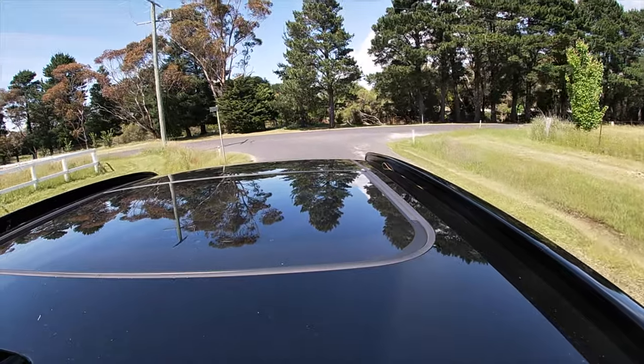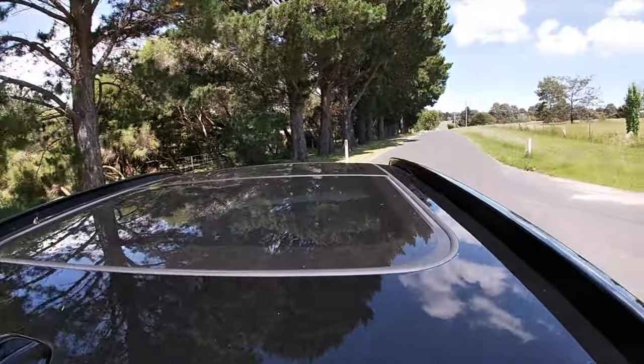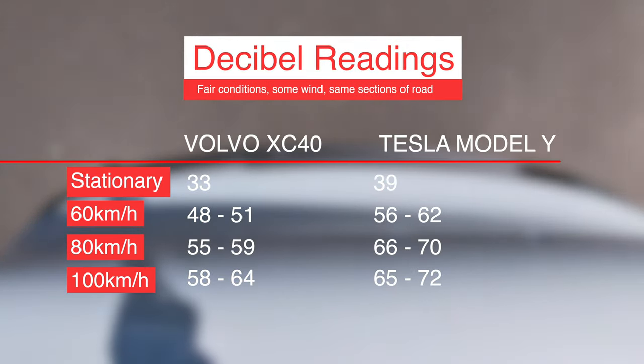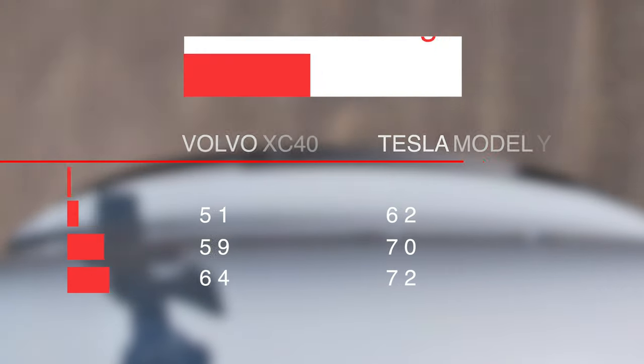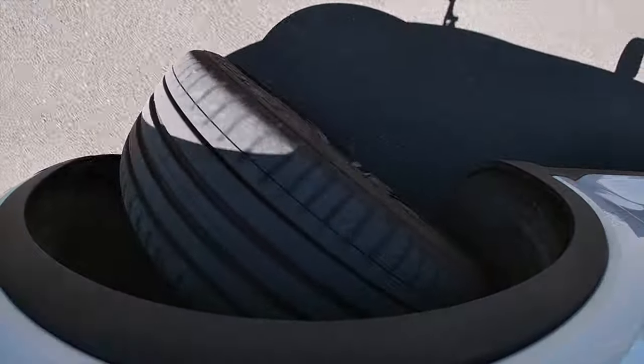The steering is nicely weighted and centred, and visibility is great — I can see really well out the front, to the sides, and out to the back. The turning circle in the Volvo XC40 is 11.8 metres, which is actually better than the IONIQ 5 and the Tesla Model Y, though the Kia EV6 and others are smaller. Noise levels are pretty good and comparable to the Tesla Model Y, though it could be improved with laminated glass and perhaps swapping the 20-inch sporty rims for something more accommodating on Australian roads.